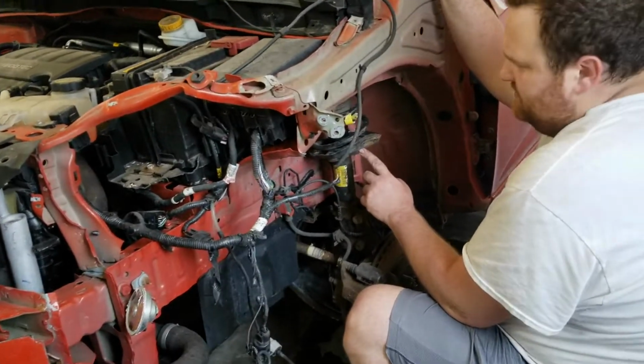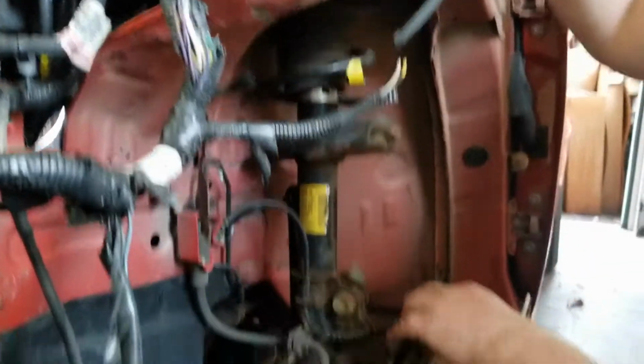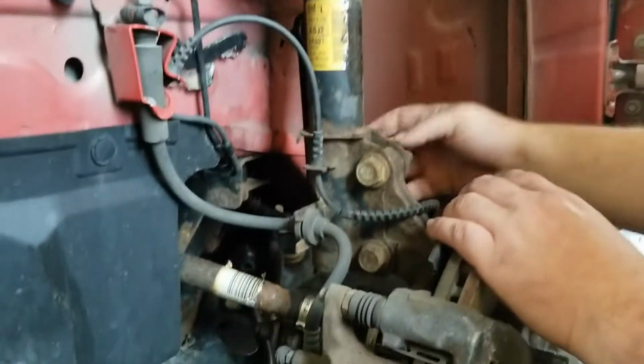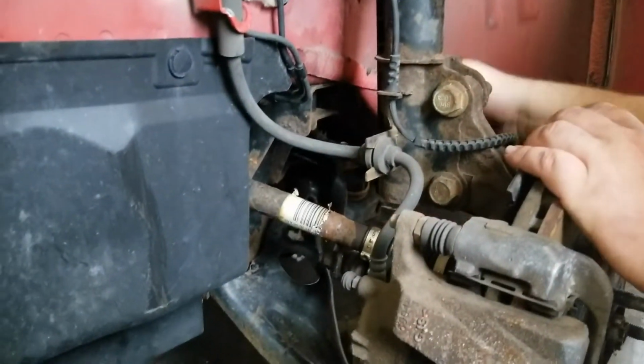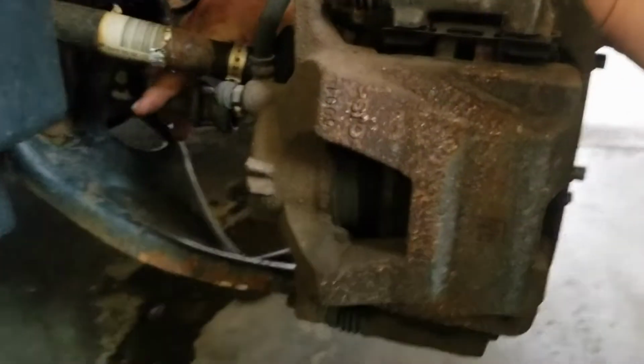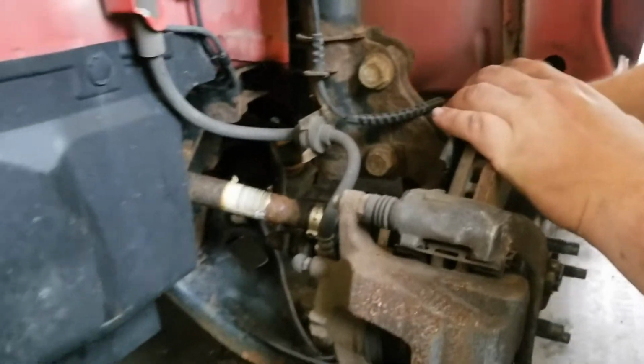The plate is super bent on it. But I don't know if it actually would have affected the drivability of it. It's a good idea to replace anyways. How much was the new one? $90, it was used. All right. Yeah, that A-arm is screwed. Yeah, it got hit, man. It got hit pretty good. The A-arm got it good.